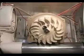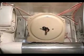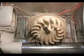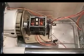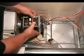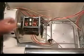Remove the screw, the clamp, and the blower wheel. Install the new blower wheel, the clamp, and tighten the screw. Set the motor in place. Make sure the blower is inside of the housing. Grab the motor and push it in. Make sure the two tabs on the motor bracket are in place.